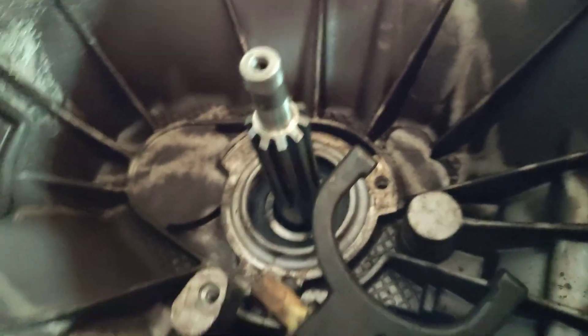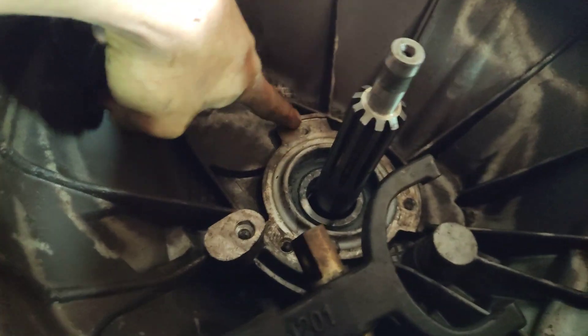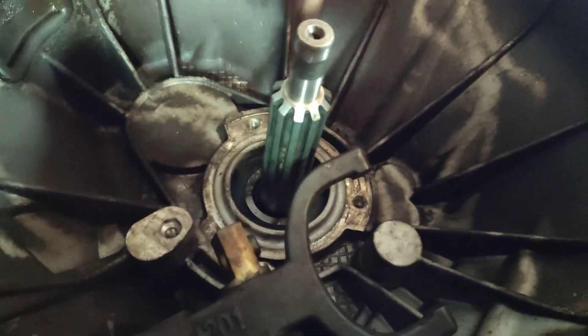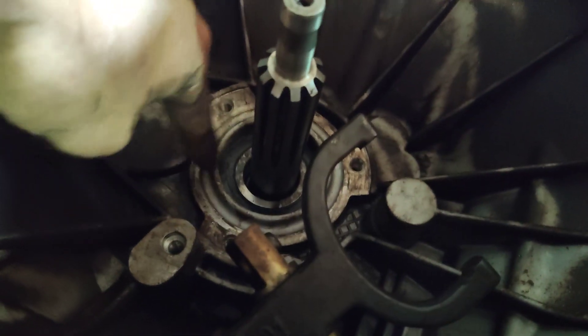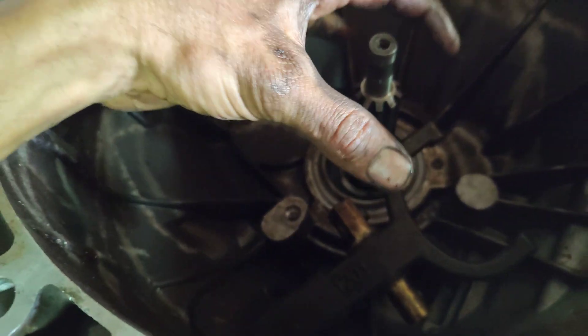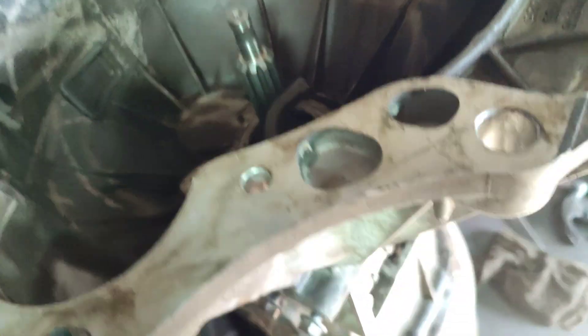You need to fabricate an extractor that grips from these three points and, once gripped, applies force here. But this bearing is very tight — terribly tight. Therefore you must apply heat. If you apply too much force without heat, you will crack the case.